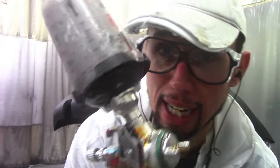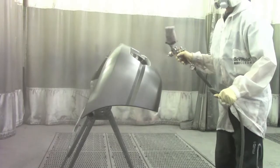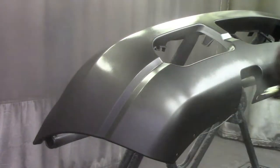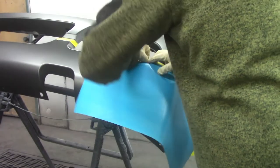I'm going to put three to four coats of base coat on the whole bumper to cover everything and let that dry while I go paint my next job in the other booth. I've got four coats of the metallic base coat on — it's completely covered. When I come back this is going to be completely dry. I'll take off the masking on the bottom so I can put my second coat on the top and repeat on the truck while I do the black, getting everything done in one shot.